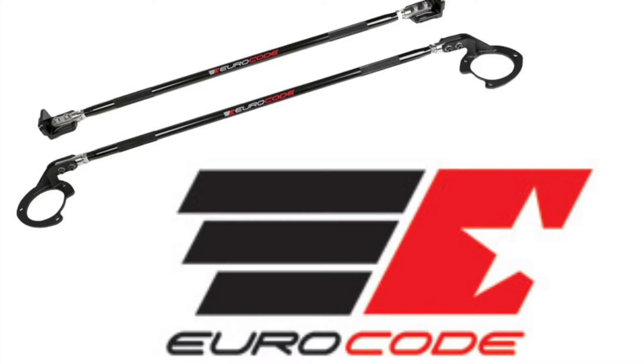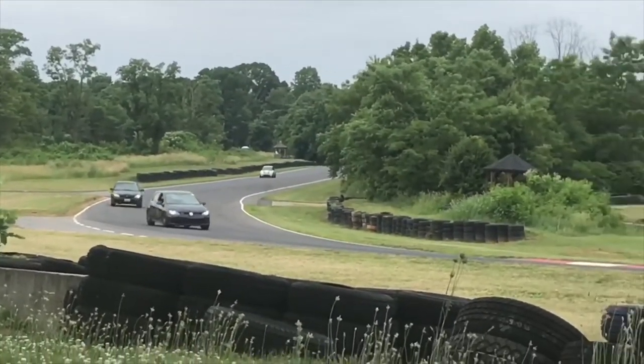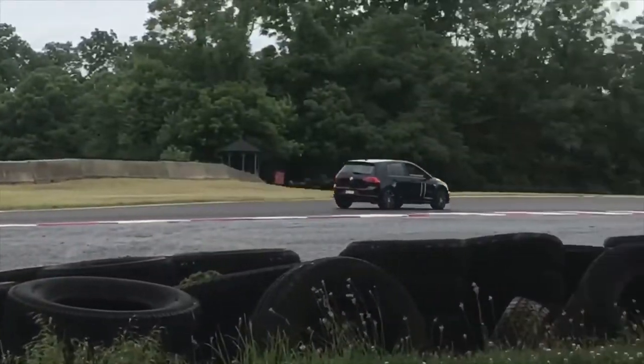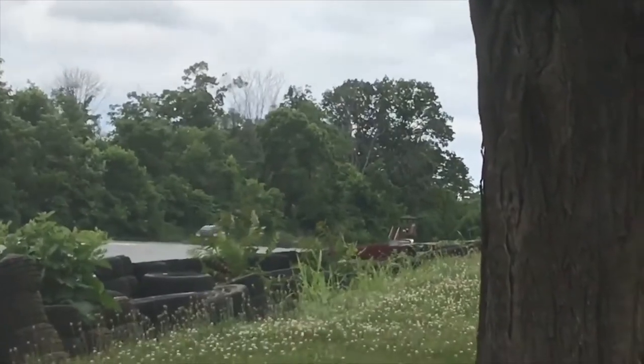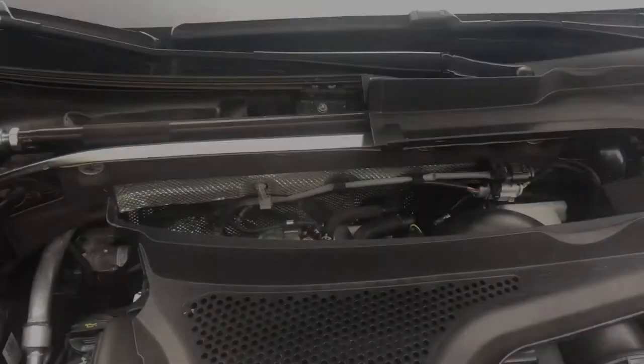As soon as you install these you're going to instantly notice a lot more stiffness in the chassis. Just turning left to right on normal streets you'll notice the whole body moves together instead of that little bit of flex. This is really going to improve turn-in. It won't help too much with body roll, but I have this matched up with a 25mm rear sway bar, which allows the rear to kick out a little more than normal and really helps improve turn-in. The chassis feels really connected now — before, steering was a little dull and light, but now it just responds immediately rather than having a little bit of looseness.